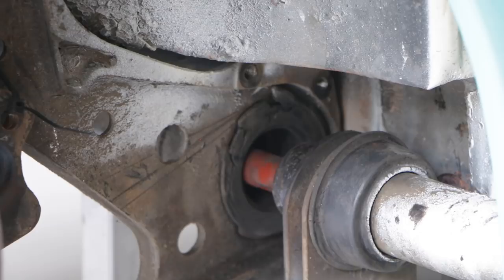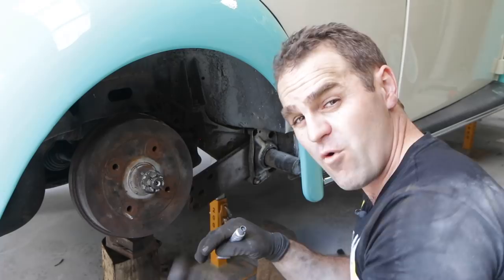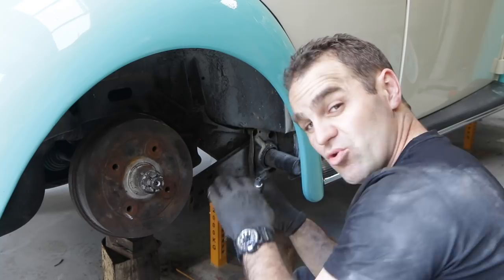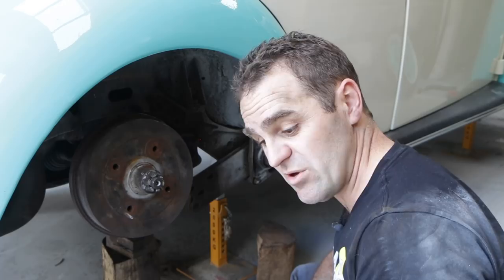It's a matter of feeling where those notches are to get the car sitting at the right point. I worked it all back and forth, marked it before and after — scratched a mark on the arm and body to see where it originally sat. Now it's sitting slightly higher as a measure that I've got it about right. I'll put a bit of anti-seize on the bolts and bolt it back up. It's also worth noting you should generally replace the rubber bushes when you do this — I didn't realize that until about an hour ago, so it's not getting done this time.